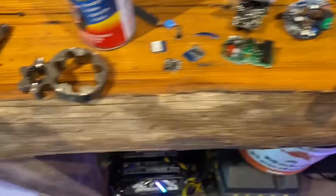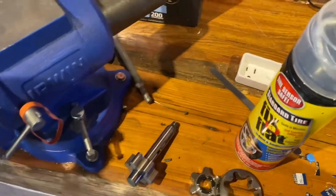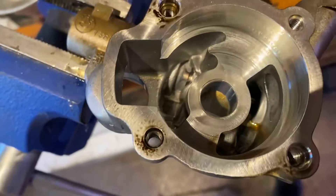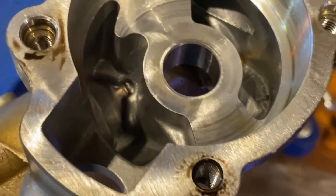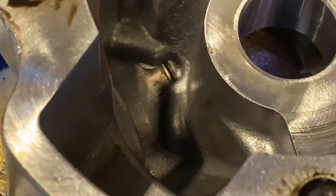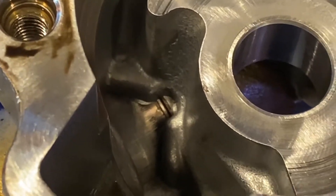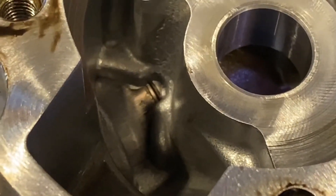The rear chamber looks great, the key was still in the shaft. These are the face gears on the front — the rear looks good. I'm not sure what I should be seeing with this valve here. It almost looks like the bypass is partially open. There it is — I've closed it now. In the middle of your screen where you see that little ridge you can see just how damaged that thing is. The bypass piston was jammed ever so slightly open, and if the engine was running there might have been enough oil coming through, but cranking over, this thing was never going to get oil pressure. That's a bummer — I don't even know if I can get that piston out and replace it. I think this pump is just hosed.